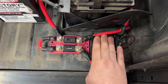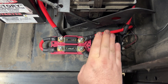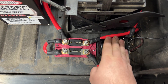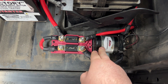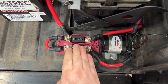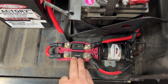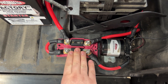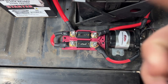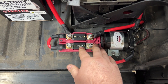That's basically how you need to make sure your vehicle is wired for safety reasons. If we kill this disconnect, the alternator is on the battery side of the disconnect, so it is going to kill the motor — the motor is not going to stay running. If the alternator was on the vehicle side of the disconnect, your motor is going to stay running and track crew tech is not going to be happy about that — and that is actually a dangerous situation. Make sure your alternator is on the battery side of the disconnect and preferably have some fuses for anything that has a battery cable hooked to it. Go ahead and like this video, give us a subscribe to see more race car related wiring videos, and thank you for watching.